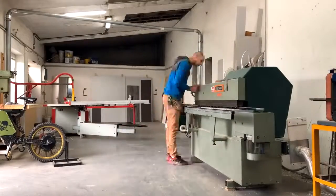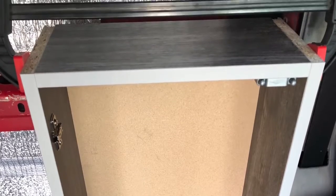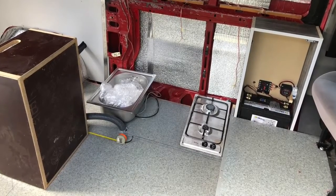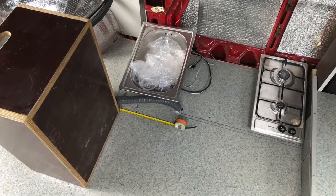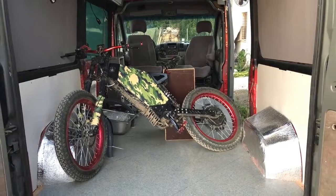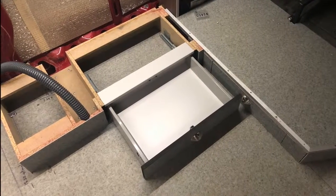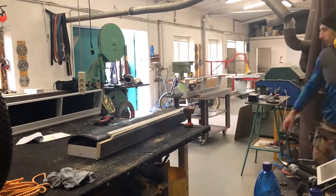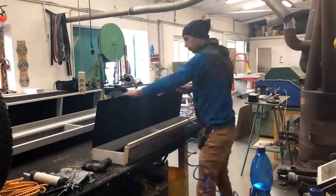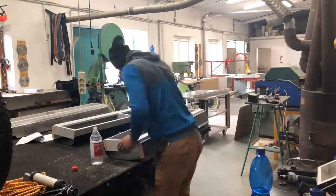For furniture, different people use different materials — the best one is lightweight plywood, it's pretty solid, doesn't warp with humidity, and is super lightweight. I used free material at my workshop: 18mm chipboard commonly used for furniture in Europe. E-bikes are the biggest cargo dictating the layout, so I loaded them in, made sure they fit, then marked dimensions on the ground, sides, and their height on the wall. Based on this I worked out the kitchen size, electronics compartment, entry unit, and how much space I have for garage units. I started with the overhead units, making the frame as light as possible — cutting strips, edging them, cutting to size. For the back I used 3mm plastic sheet that bends very easily, with black fabric contact-glued on the facing side before stapling it to the unit.